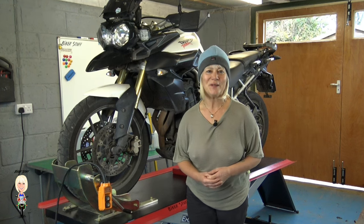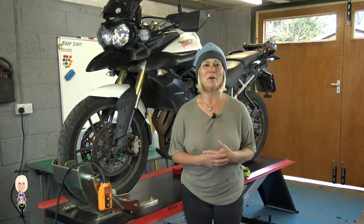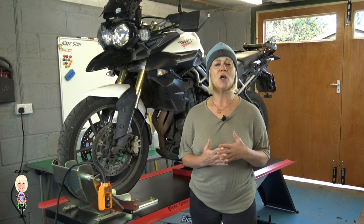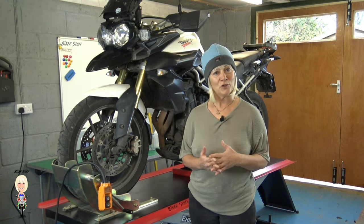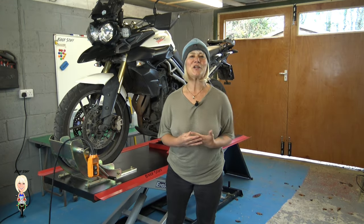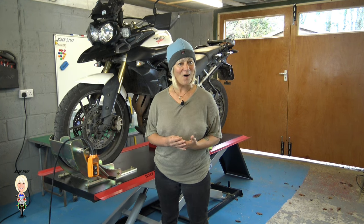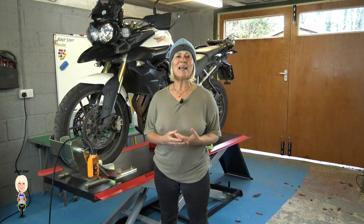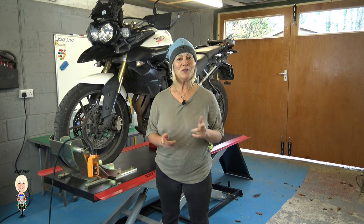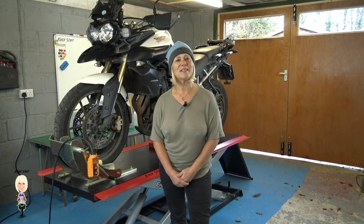Many coolants are poisonous, so please be careful with it. Don't get it on your skin, in your eyes, and don't let your pets or anyone drink it. Some people refer to coolant types by the colour they are, but the makers of it can add any colour they like, so don't be fooled. Read the bottle if you want to know what it is made from.